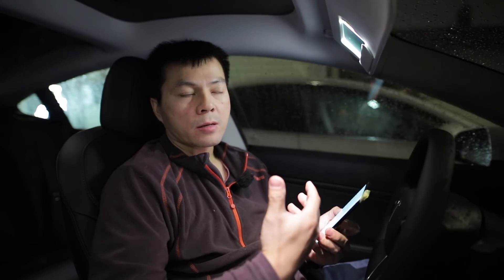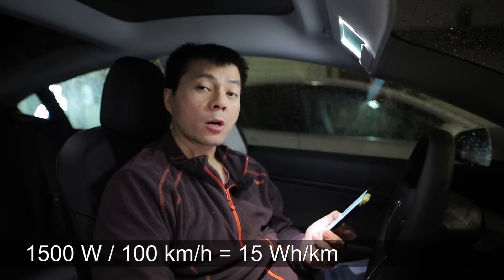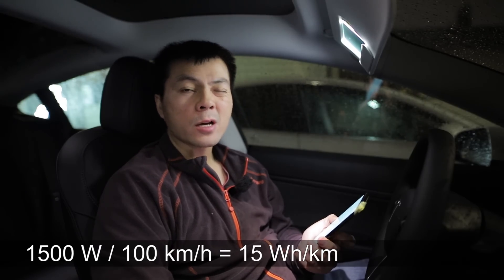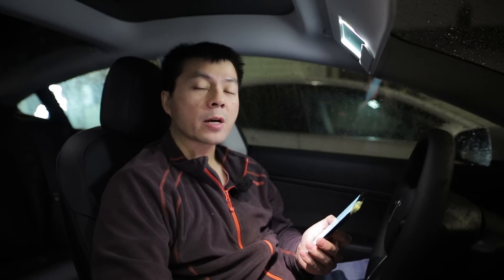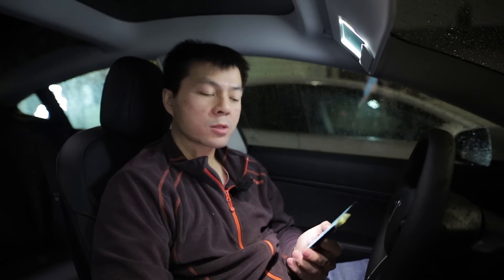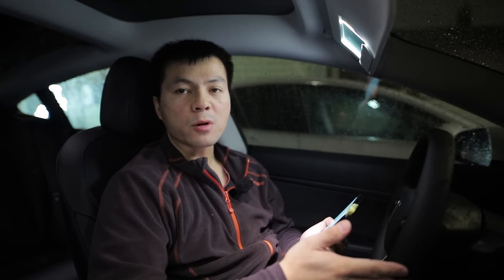What does it mean if you're driving? The power draw for the heater is higher for both cars while driving, but if we assume the difference would be 1,500 watts, then driving at 100 kilometers per hour, that means a 15 watt-hour per kilometer difference. I think this corresponds with what I found earlier — I did a video where I tried to estimate the difference using an i3. And now with this car with the heat pump, we are getting similar values to the i3. Maybe Korean cars would be even more efficient.